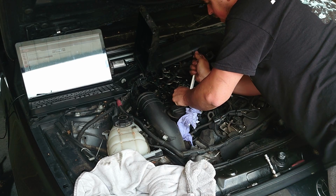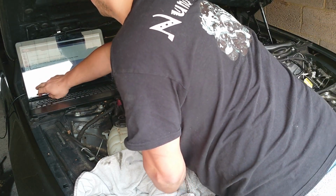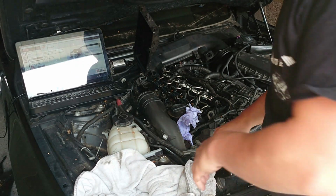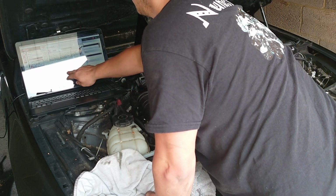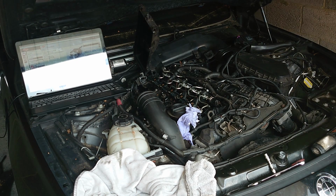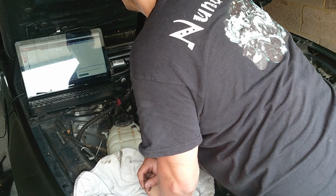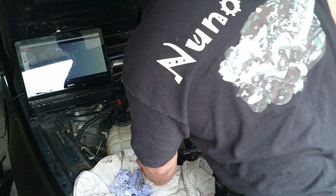Okay, the computer just says stop. So I can turn this off. Go back. And now select diesel, normal, 3 liters. Then I will delete all the codes in the system and try to start the car. Oh, it says it can't connect, so probably the ignition goes off, because after 2-3 times it goes off. No, actually it's still on, so why can't it connect? That's it. There were 2 codes in there because I was messing around with the system, so just delete everything. No codes. Okay, so what's left to do is try to start the car.